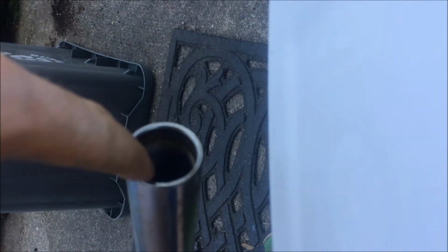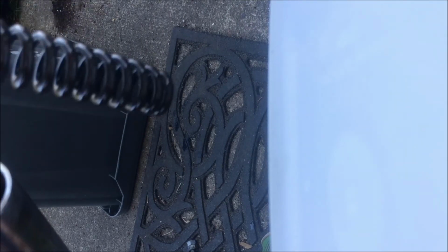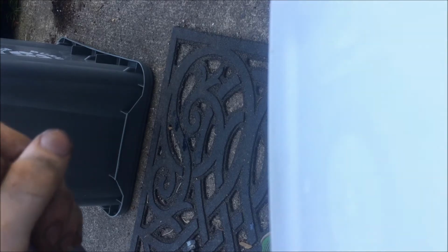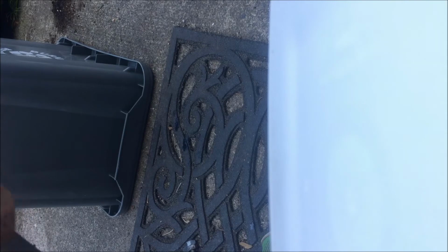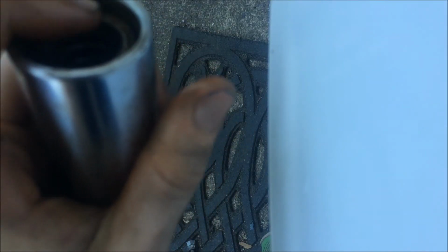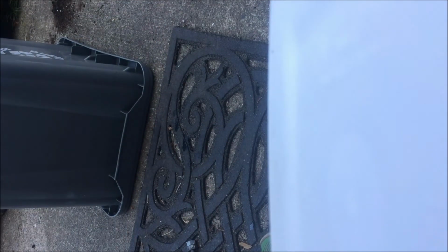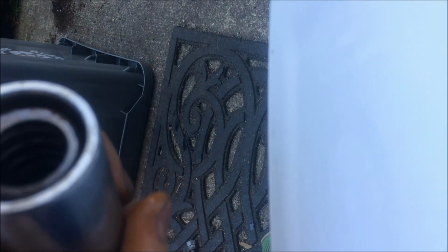Then you put your spring back in properly. So narrow end down, pull. Yes, the Allen bolt isn't in yet, but anyway, that's what it looks like. And then you put, this is when you fill it with oil actually. So 140 cc's is the spec. And once that's done, put these guys in.